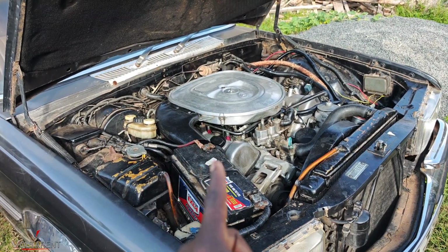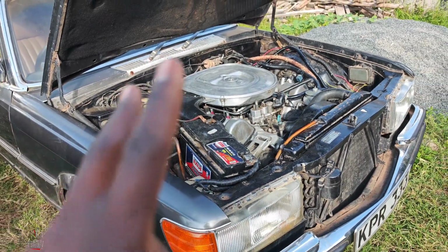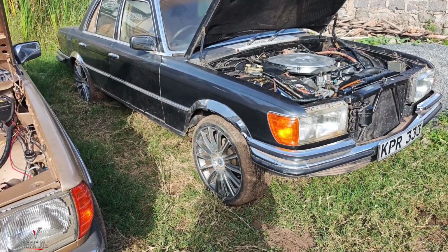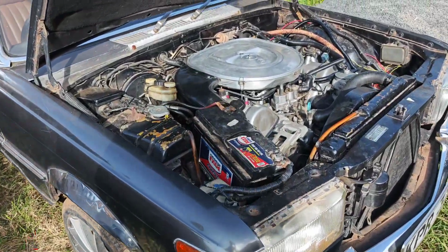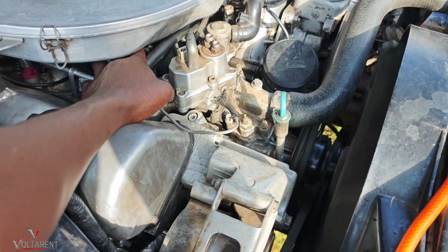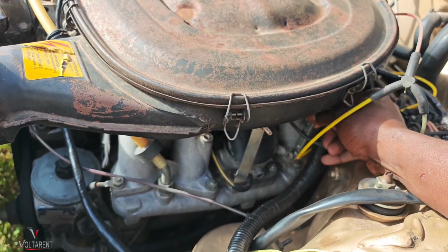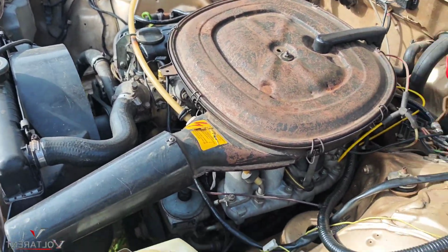Version 1 is batch, meaning every other time 2 cylinders are receiving fuel at the same time and receiving sparks at the same time. So it has a wasted spark system. Do they rev? They do. This other one, very angry.